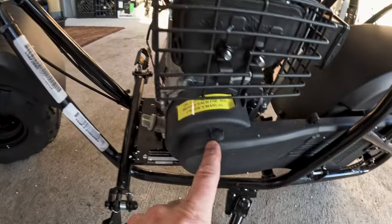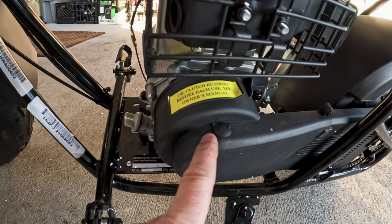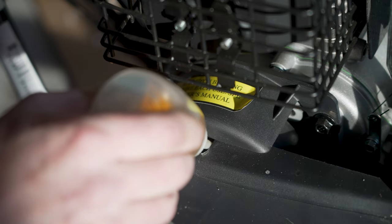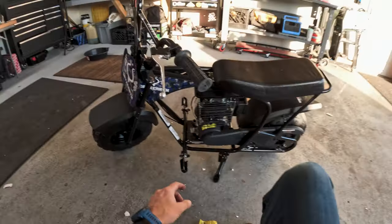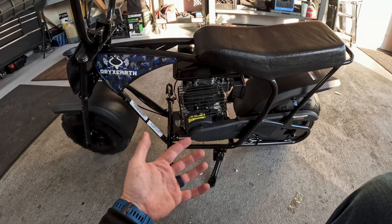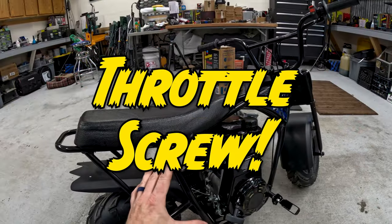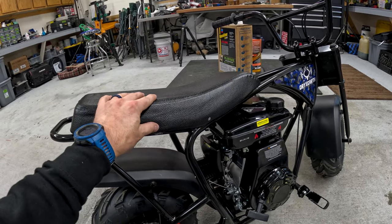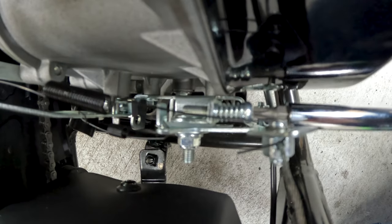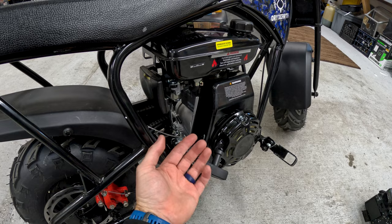The clutch bushing requires you to oil it every time before you use it, according to the owner's manual. They give you a little bottle — you drop two or three drops of oil down in there, then put it back. I don't think little kids are going to do that. That is not a great design; it's probably going to run dry and eventually go bad. Another important thing for parents and novice riders: I want to show you where to set the throttle limiter screw. As you can see, twisting the throttle hits that screw. The further you turn it clockwise, the more you limit the throttle. You can also remove that screw entirely for full speed.